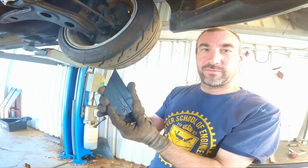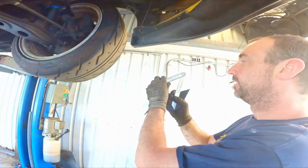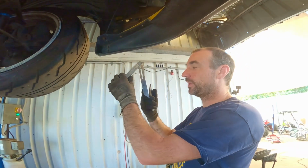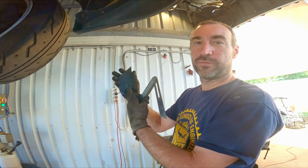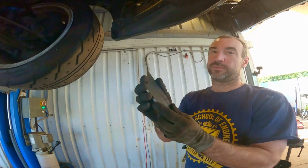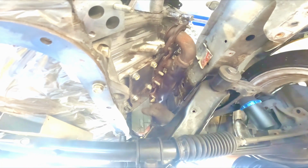So I've gone ahead and made this. I've basically got a sliding bevel and put it up on the tilt of the engine, and then vertical down, and got this angle and this angle out of it, and measured across to the intersection of the bolt and then down to the bolt position. So now we can get this here and put it here, and we've got the beginnings of our engine mount.